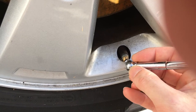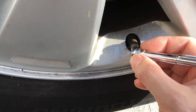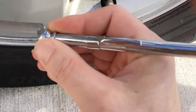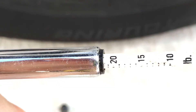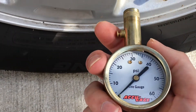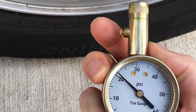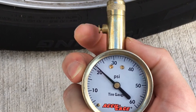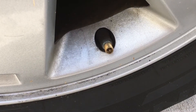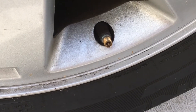Let's measure the current pressure in this tire. With the stick gauge, you have to press it on and get a good seal — if you hear air, it means it's leaking around and you're not getting an accurate measurement. This gauge is measuring 22 PSI. The electronic gauge measures 21 PSI, and the mechanical gauge also measures 21 PSI. It holds the current pressure reading until you press the button to reset it. The current pressure in this tire is 21 PSI, which is too low — the required pressure is 30 PSI.